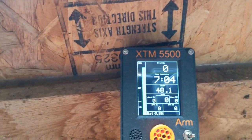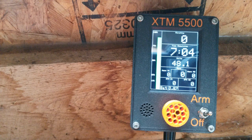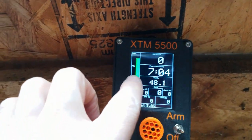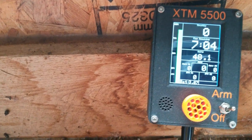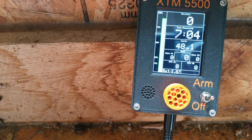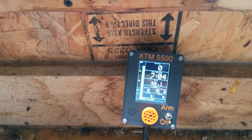It's got a buzzer — the buzzer doesn't do anything right now — but it basically gives your throttle percent and your estimated time remaining. If it's not running, it gives you the time based on the most amps you ever pulled. It shows battery percent, volts, amps of motor 1, amps of motor 2, and your combined amps that you're pulling. Then your RPM for each of the two motors as well as the battery voltage for the controller.